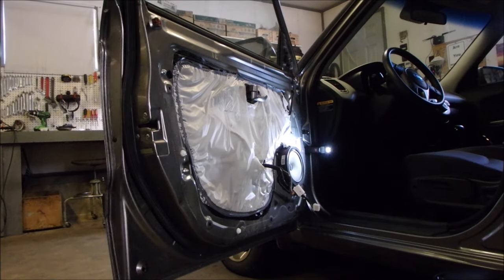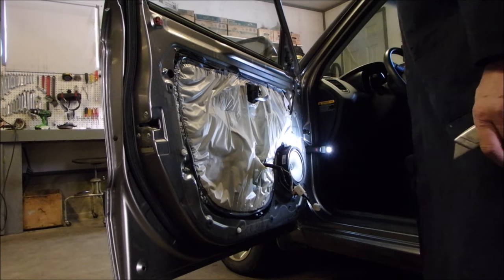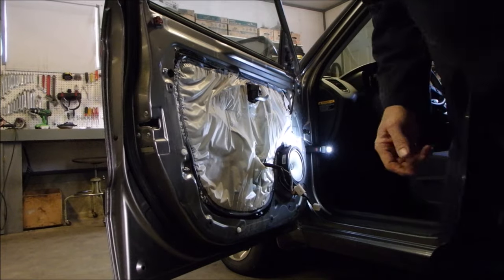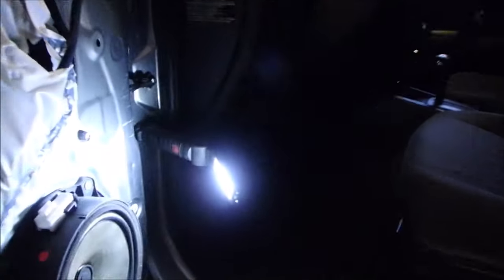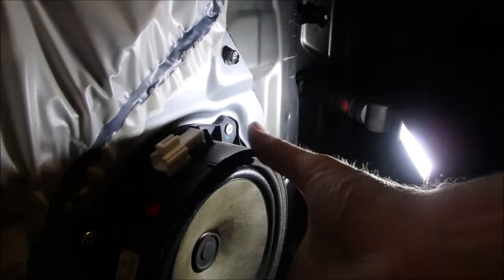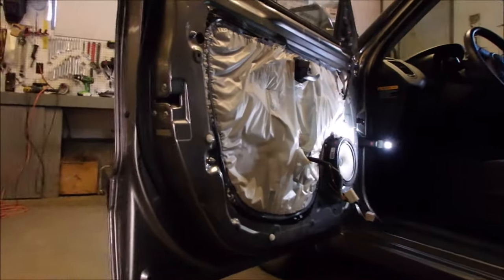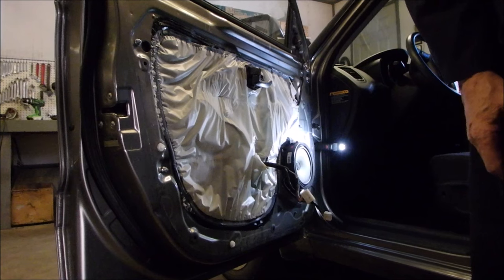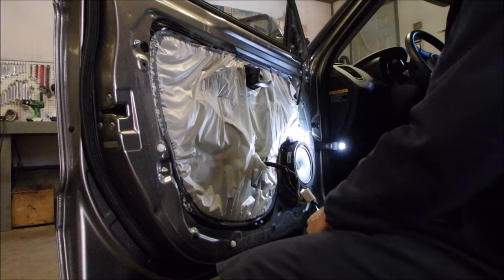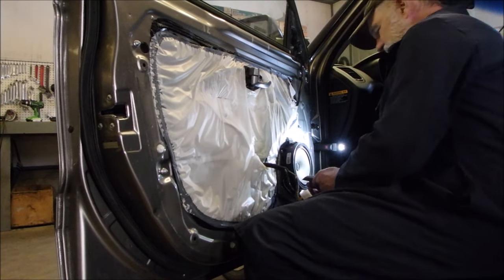Okay, my friends. This time, I'm not gonna take out the speaker enclosure. I'm just gonna cut the old speaker out. Cut the wires. Cut this ridge out of here. This is the ridge I was talking about right here. Because my speaker is exactly the width, so it was kind of distorting. Yes, I will lose the foam a little bit. But let's do it. Really feels weird sticking a knife into a good speaker, right? But is it a good speaker?